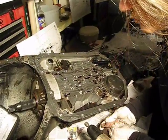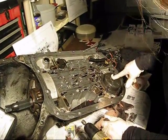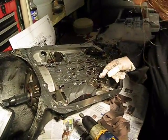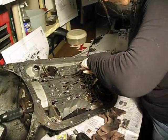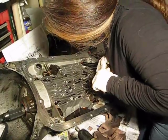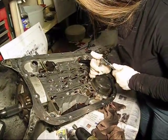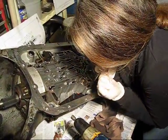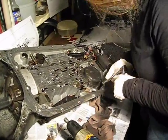We removed six retaining bolts for the reverse servo cover and removed the reverse servo cover. So that looks like a 10mm. It's good because I've got my 10mm. And it's on there tight. It doesn't help that I'm sliding on the floor either.